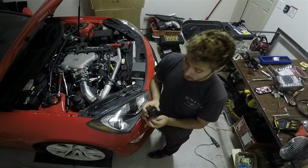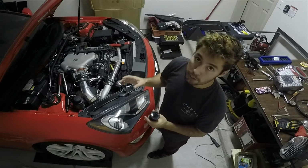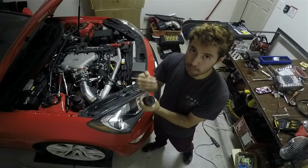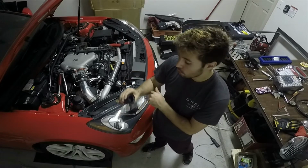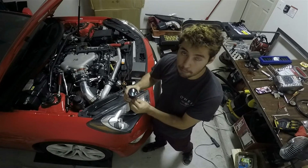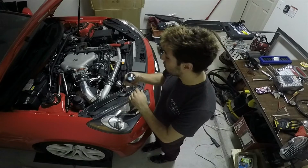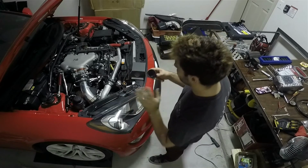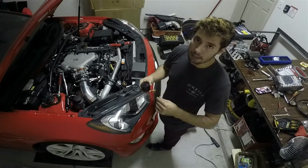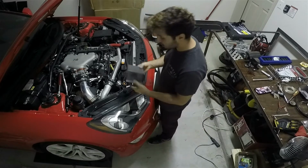Now this is a mechanical boost gauge, which some people enjoy because it's a little bit quicker than the electronic boost gauges. The electronic boost gauges have to convert the boost signal to a voltage and send that voltage to the controller where it then moves the motor that displays this. This one's all set up with springs, so if you blow on this or whatever, you get your boost on here. As soon as that boost picks up, assuming that you don't have a very stretchy hose, you'll get really, really nice sweeps of the needle and everything will be much more precise as well as a much quicker response time for your gauges. So that's how I recommend having it set up. I think they're a little bit better, but sometimes it's a little bit more difficult to get the lines for the vacuum hose routed comfortably, where electronic wires might be a little bit easier to go through. And that's basically all that's in the box.